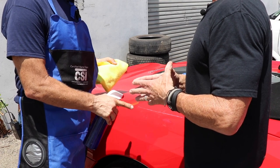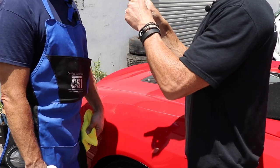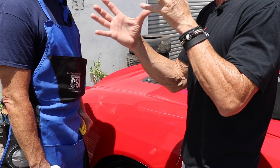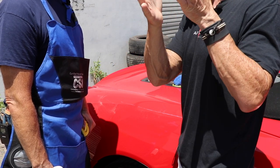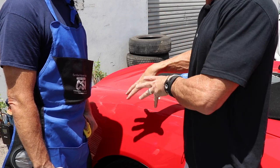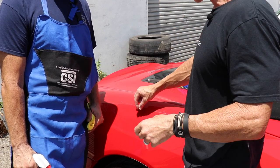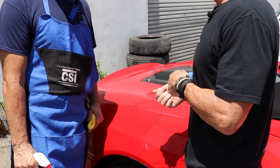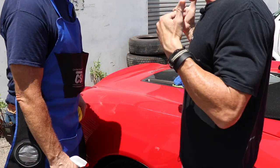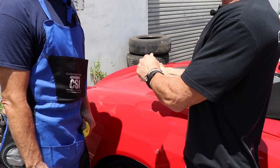If you're using a compound or polish made with heavy solvents, it will literally bubble the paint. Put a bead of typical compound or polish on the paint, let it bake in the sun, then chisel or wipe it off — you'll see the paint actually domed and bubbled up. When I was training Sean — the guy I'm mentoring — he started polishing the car, then stopped to ask questions. What I wanted him to be aware of was: moving forward, if you apply compound to a panel and then stop for lunch, you're going to be in trouble.